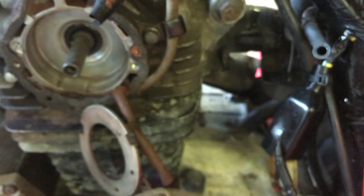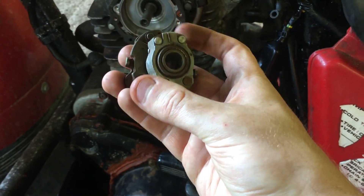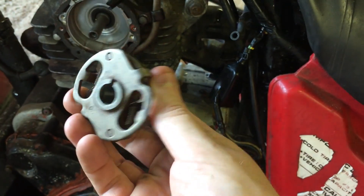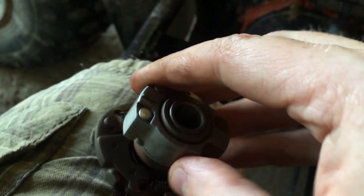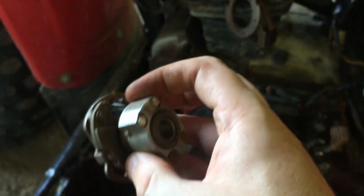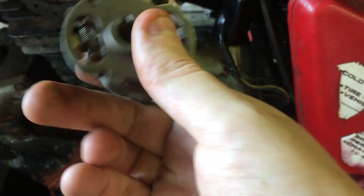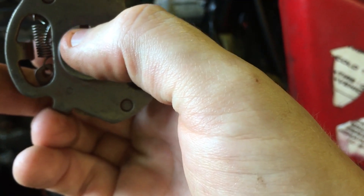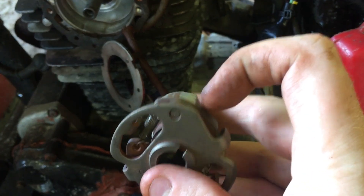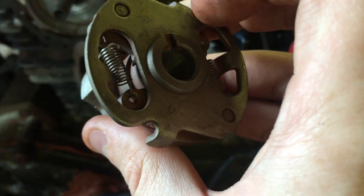That bump corresponds with this piece — it's basically a spline, so you can't mess it up 180 degrees out; it only goes on one way. The issue many people have is that with the bolt out, someone can take this magnet fully apart and install it 180 degrees upside down. So how would you know it's oriented correctly? You see that bump on the camshaft — the top of the magnet right here should be close to that bump.